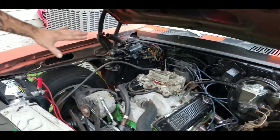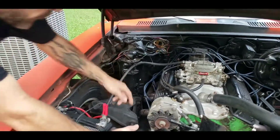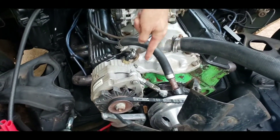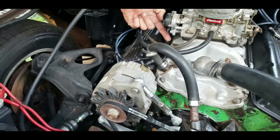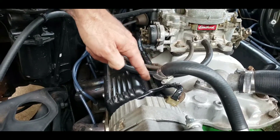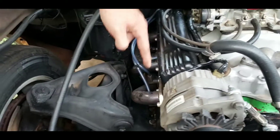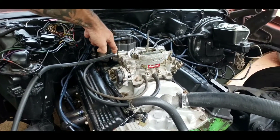You already have very minimal rubber in your lines, so I think you're okay there. However, your fuel lines are routed up behind your alternator and it looks like even in between your timing cover and your water pump, and they hug your intake very closely. They run so close to the intake that it's quite possible that the fuel in those metal lines is boiling. So I would suggest trying to reroute your fuel lines so that they can come up as far away from the engine as possible.